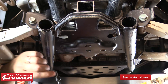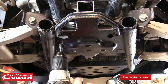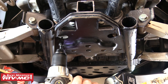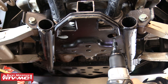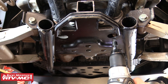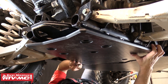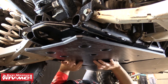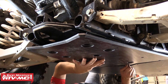There are two holes near the rear of the frame that need to be tapped. Using one of the factory thread cutting bolts, we're going to run that bolt up through each one of these holes to create new threads for the new bolts. After we have that done, we can position the rear skid section up into place. There's a lip at the front that we'll want to slide underneath the middle section of the skid plate, and then we can attach it using one of the stock bolts and washer into the front most recessed hole. We'll leave that finger tight for now.